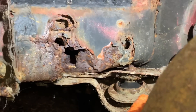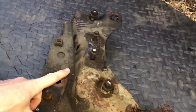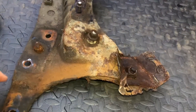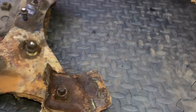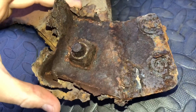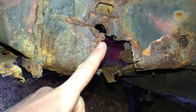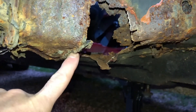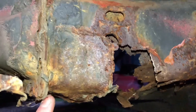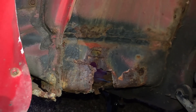That's for the wishbone mount - the wishbone mounts to here and then the bracket mounts to the actual floor pan itself. I've just removed the driver's side wishbone to show you a bit more. You can see this is the bracket that holds the wishbone - it's sandwiched in between here, and this last bolt at the end bolts to the floor pan. This is a plate welded into the floor pan - you can see the spot welds. Once I started undoing that, instead of undoing the bolt it's literally ripped apart. You can see the rust, and I've noticed it's had a bad weld done in the past. The bodge repairs are always the ones that cause the issue - this was probably all caused by this crappy repair.